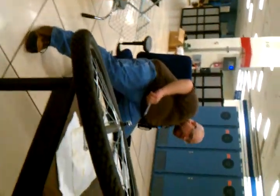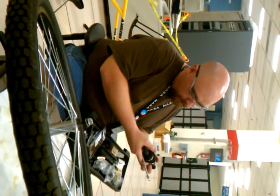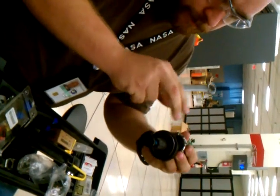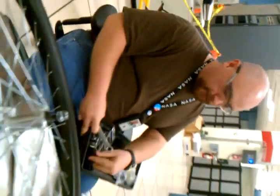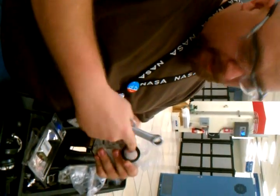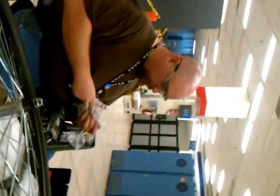There's multiple types of bearings you can find on a bicycle. Loose ball is a classic type that isn't found on a whole lot of consumer bicycles anymore, but it's probably the most common type of bearing you'll find on old style bicycles. The next most common on older ones and on some budget ones are bearings that are in these races. The process for taking care of these types of bearings will be almost exactly the same as taking care of the loose ball. The third type of bearing, which we won't be dealing with today, are sealed bearings. On sealed bearings, the races are built in and you never actually see the balls themselves. Basically on these types of bearings, when they go bad, you just throw them away.